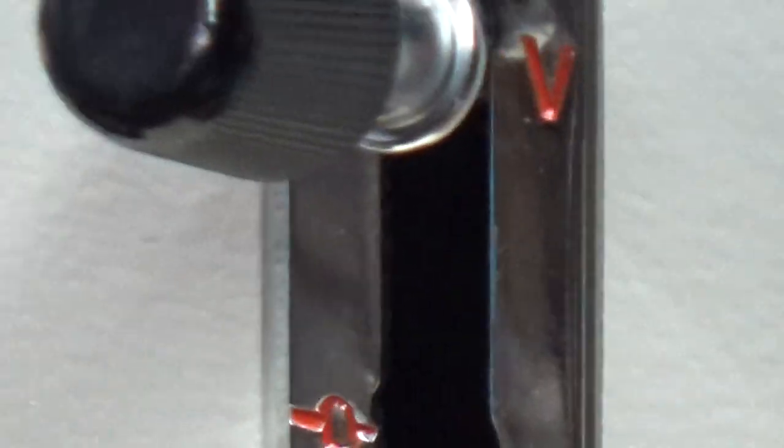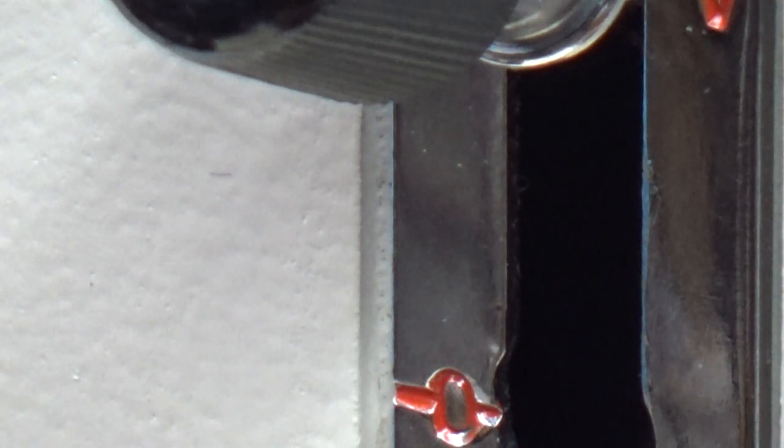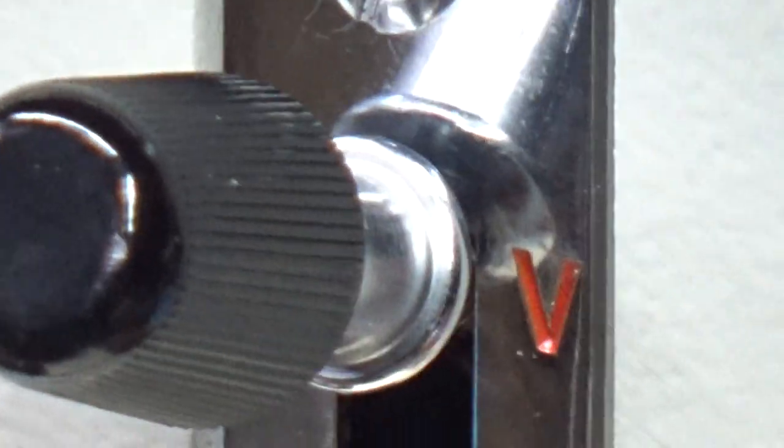As you move the lever down from the top towards that zero in the middle, you're going to shorten that stitch up, just above the zero to pretty close to 25 to 30 stitches per inch. So it's going to have a comparable stitch length range as a number of the machines have, around 5 stitches per inch on the high end, all the way down to 30 stitches per inch when you get real close to that zero. And again, like any machine, if you get too close to the zero, the material is hardly going to be moving. You're going to have probably a mess down at the needle if you try to shorten it too much. So just be mindful of that if you happen to own a machine like this.